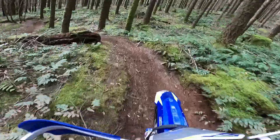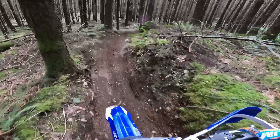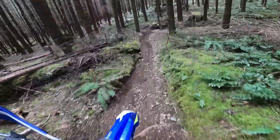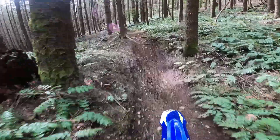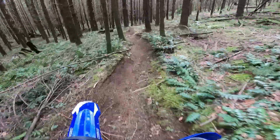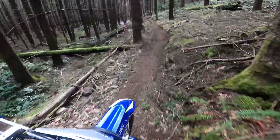Like I said it was a bit rich when I first started riding and I've leaned it out a bit, got rid of that little bit of bog that was there when you crack the throttle. Now it's got good snap.